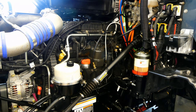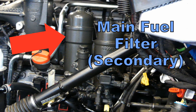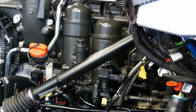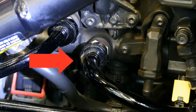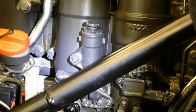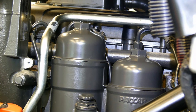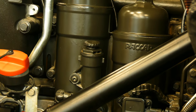For EPA21 engines the filter module has changed a bit. There is no longer a chassis side filter and it has been moved into the module itself. Here you see the main or secondary fuel filter on the left and the primary fuel filter on the right, once known as the chassis filter. The fuel line orientation is the same — the left line is return and the right line is suction, so you would still hook up the mighty vac to the left side. There is the new hand primer pump. While the mighty vac is running, you crack both of these filter caps loose and let the suction pull all the fuel out of the bowls.